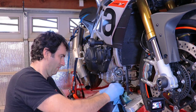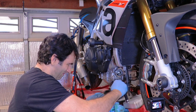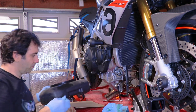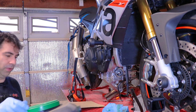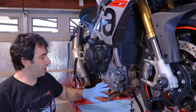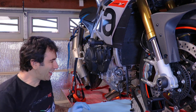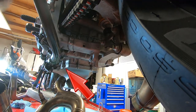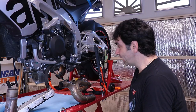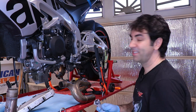If you have the right tool, this clamp is off and the hose is out. There should be no more oil in there, so we can move on. Now the only thing left to do is remove the eight-millimeter bolts all around the oil pan, except for one allen bolt. I'm gonna start removing them — fingers crossed it doesn't start leaking.